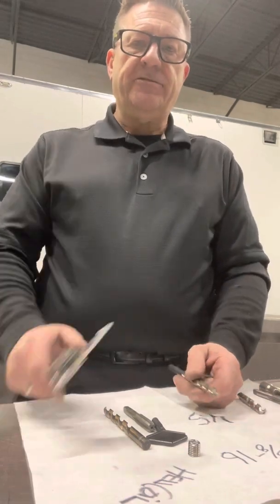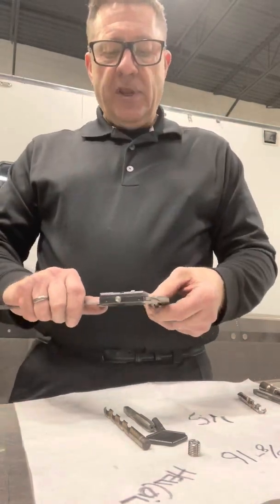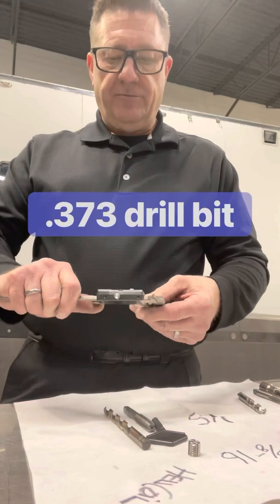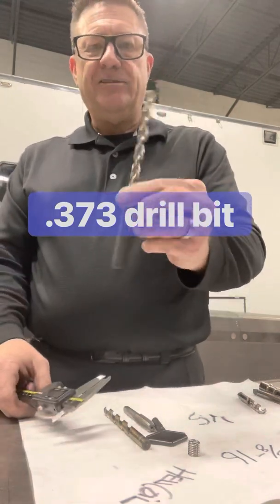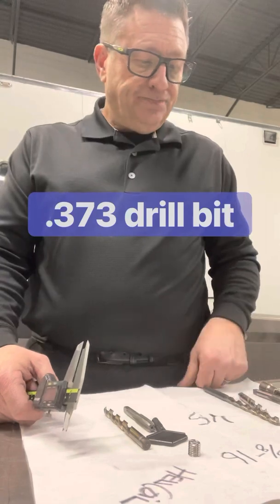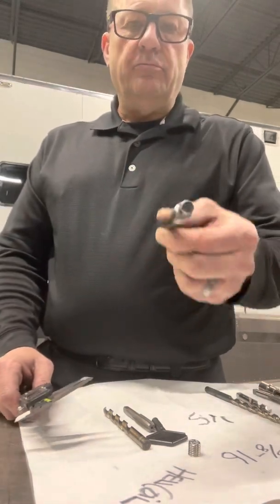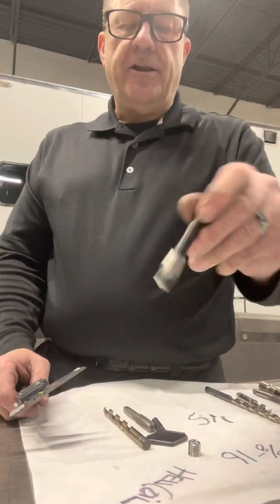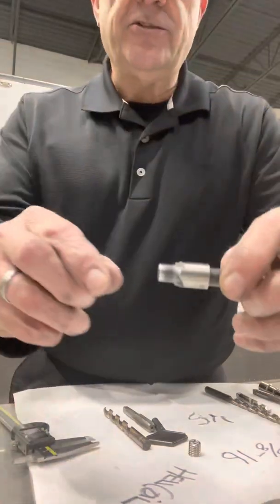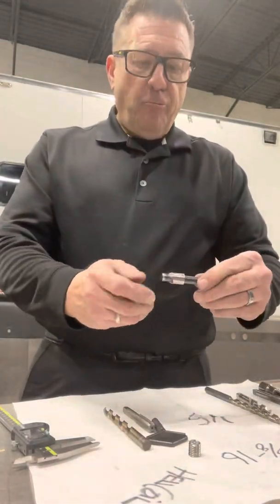I decided to reduce the size of the first drill hole for the tap. I found a drill bit — I think it's a 9mm — that ended up being just a shy under three-eighths, about 0.373. It's a big long one, but it's a millimeter size so it came out right. When I first drilled the hole to bore the top for the TimeSert to sit down in, I noticed it was already tight in the hole, but I did get the bore in it okay.